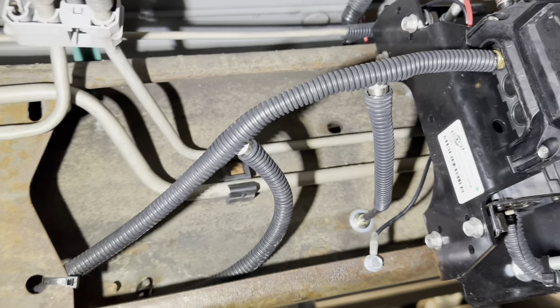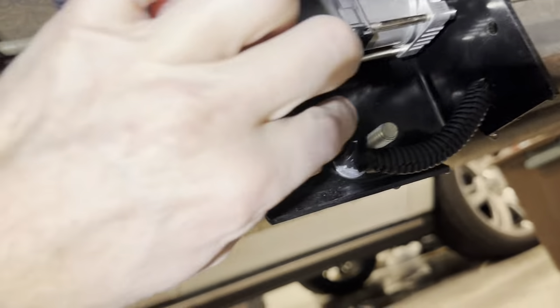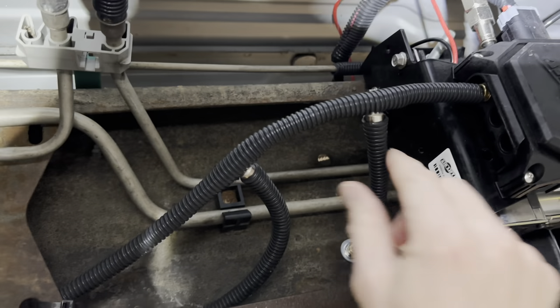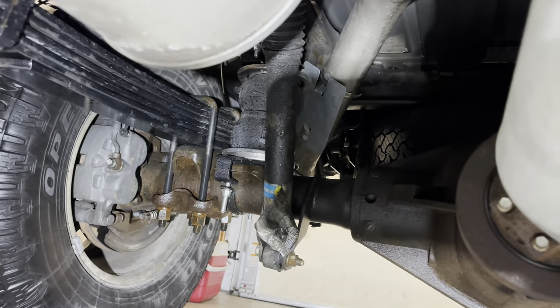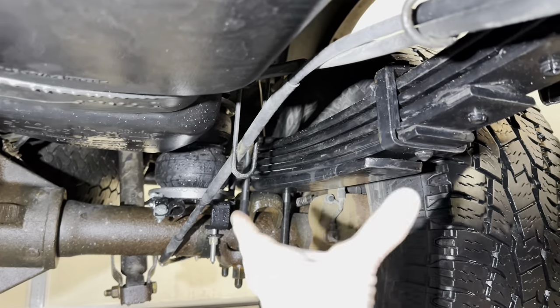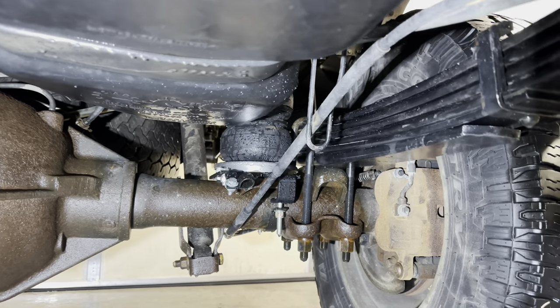Here's a final look at this with the wire loom on. Put some soapy water on it — everything tested out just fine. One little zip tie there. Everything turned out pretty good. A little zip tie there to hold it — it's pretty solid and shouldn't have a problem. Hopefully the bags are all good. I did end up getting some new springs on there — I think those are almost one-ton rated, or 2,300 pounds each side. Probably need some new shocks. Those Bilstein shocks aren't that old — probably only have 15,000 miles on them. If anybody has some good ideas on some better shocks, the springs were completely depressed the other way so I had to upgrade those. But it rides really nice with the new springs and the new airbags. Really happy with it — can't wait to tow with it this summer. Should be a good setup. Have a good one.